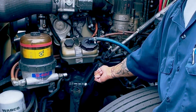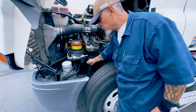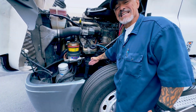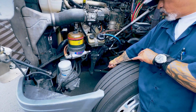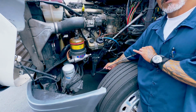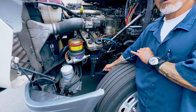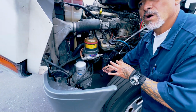Power steering box. It is gear driven. I should have no cracks and no leaks. All bolts are bolted tight and secure. My steering linkage. This is my drag link. No cracks and no illegal welds. Castle nuts, bolted tight and secure and not missing. Cotter pins, not cracked or missing. This is my bushing, not cracked, missing, well greased.